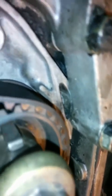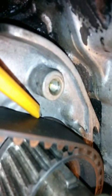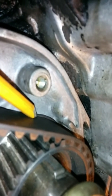The order you do things is important. The first thing you do is line up the crankshaft on this little mark — you can just barely see a little half moon that is cut out of the pulley, and you line those two up. Start putting the belt on by this little white mark here; there are some little dots that form a line on the belt, and you line this white mark up with those three dots on the belt.